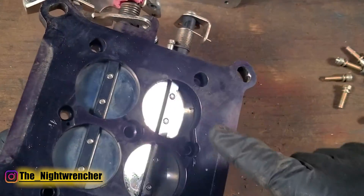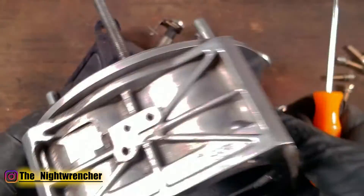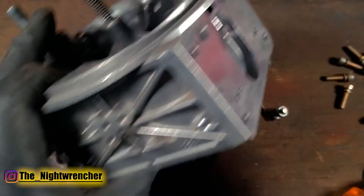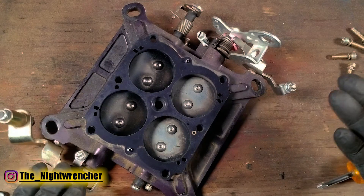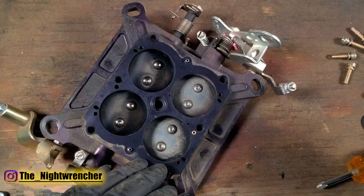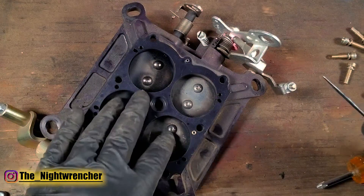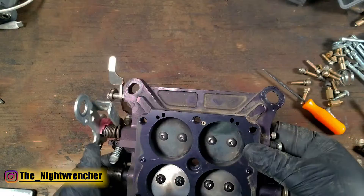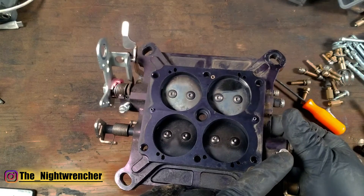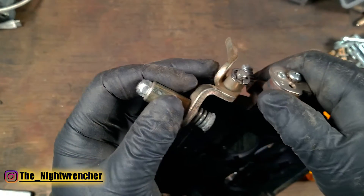A backfire travels up through the orifice, through the brass plug, up through the main body, and the pressure exits right at the diaphragm. If the diaphragm is fairly new there's not much to worry about, but after a few cycles a backfire could blow it out — then it'll dump raw fuel into the intake and the car will run super rich. There's really nothing to rebuild on the base plate itself. The Proform base plate has stainless steel throttle blades and idle adjustments on both primary and secondary sides, and none of that is a wear item.